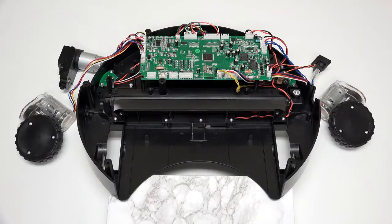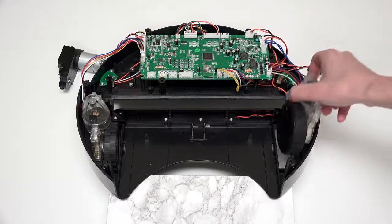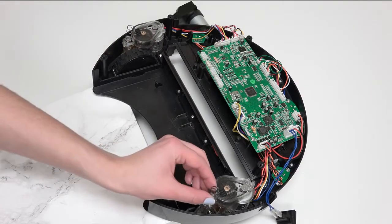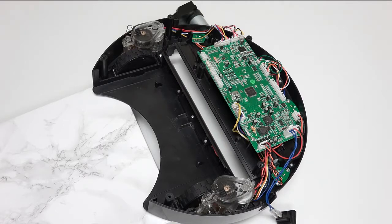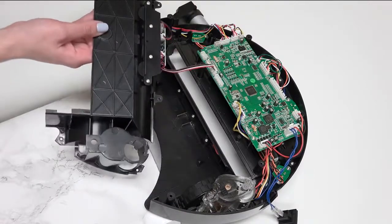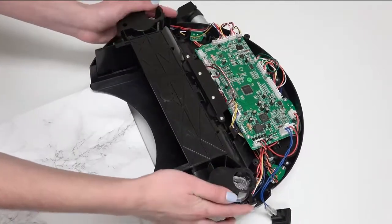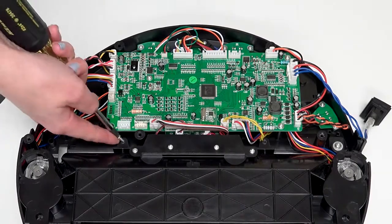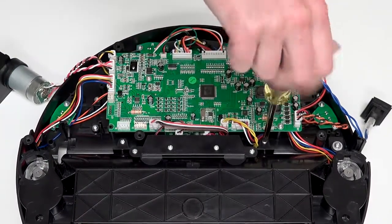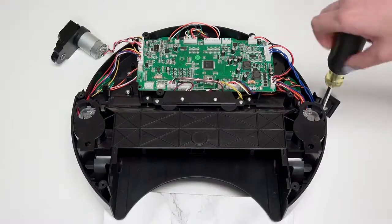With the back of Bob still tilted up, replace the left and right wheels if you have moved them. Replace the two springs on top of the wheels. Plug the wheel cover back into the mainboard. Clear the area of any wires that may become compressed underneath the wheel cover. Then carefully align the cover with the screw posts on Bob. Make sure the springs on top of the wheels do not move out of place. Install all six screws previously removed from the wheel cover: two just behind the mainboard, two around the left wheel, and two around the right wheel.